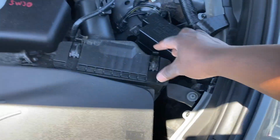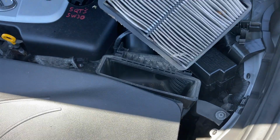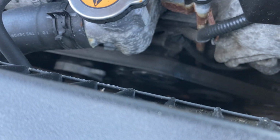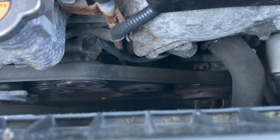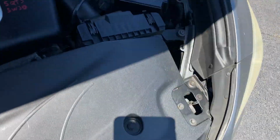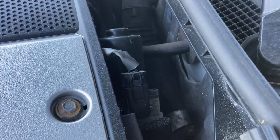If I were testing it in the winter, it would be great because you can test the heat. Again, just looking. At least they're not wet with oil or anything. Alright, look at the belts, just what they look like. The pulleys. See any leaks? The water pump is usually somewhere around here in these engines, I believe. I don't see any evidence of leaks. It looks dry down there, that tray. I believe the bleeder hose is usually somewhere back here, out on this side. I'm more familiar with the V8s. Yeah, right here. Looking for the hose. I don't see where the bleeder is for the V6, but no leaks yet.